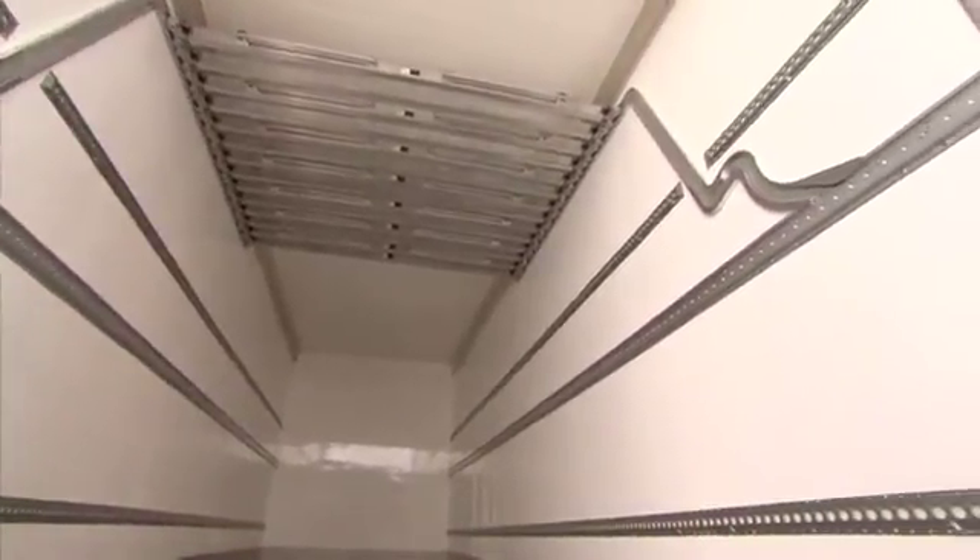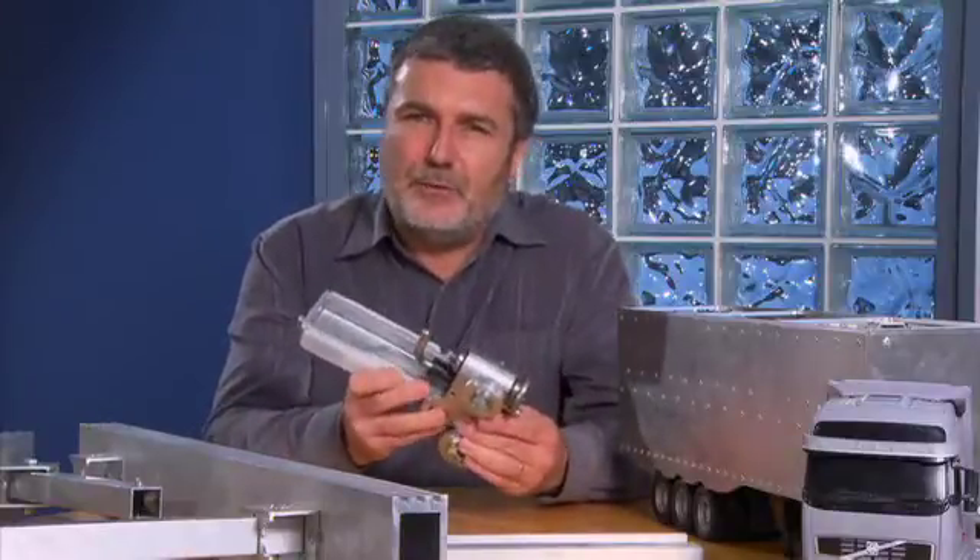This system looks good in the truck and it's strong. The engineers specified stiffness, strength and ductility — that's shear strength or resistance to fracture. These trucks are under enormous loads and this particular component has to endure about two and a half tonnes worth of shear strength. That's why we specified strontium modified LM6 as the alloy and it's been really successful for us.